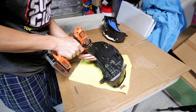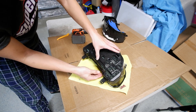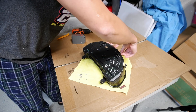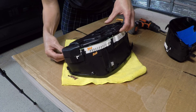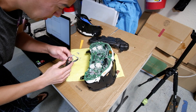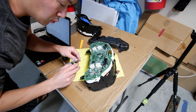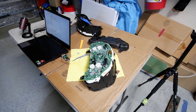To take the cluster apart, remove all the screws on the back. Once you get those off, there are only a couple of clips holding the back cover on — about three sets of clips for the middle, front, and back. You want to release just the back ones; the top has no clips so you lift the front and then release the clips at the back and lift it off. Inside, the EEPROM is labeled IC2 on this cluster. Unlike the IS300 cluster it has no flux on it. The IC2 chip is an RA57, which is equivalent to a 93C56 EEPROM — just clip onto it.